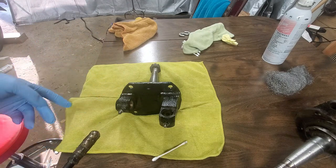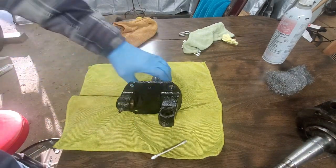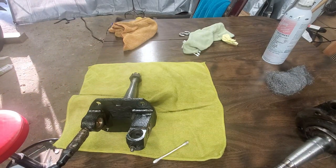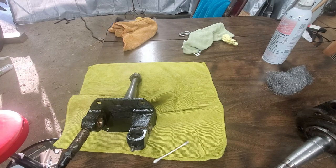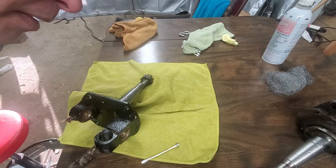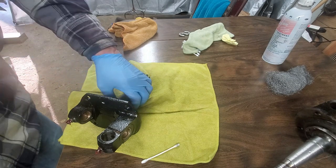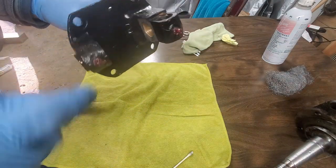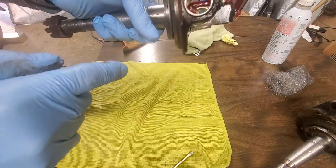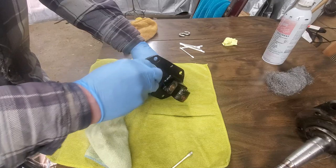Okay, now we're ready to clean these up and put them in. The first thing I want to do is run some grease through these fittings to clean out any metal shavings in there. Wow, look at all that. I don't have the spindle arm in it, so it's not going to go through into this hole — I'm going to have to clean that out with a Q-tip or something. I don't know whether you can see all the shavings in the end of it — I think there's quite a few in there, so let's wipe that out.